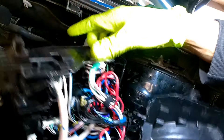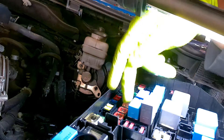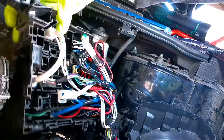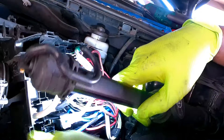Now that we're here - if you had to replace the 120 amp fuse right here, at this point you would need to push this whole section downward in order to gain access, because it's secured by two bolts on either side. I'm not doing that right now - what I'm doing is different, we're just trying to figure out why we don't have power. But like I said, if you were to do that job, once you get to this point the rest is not that big of a deal, trust me.